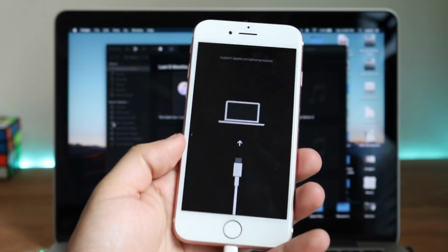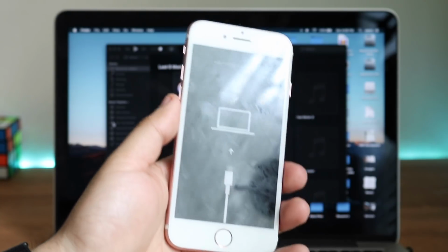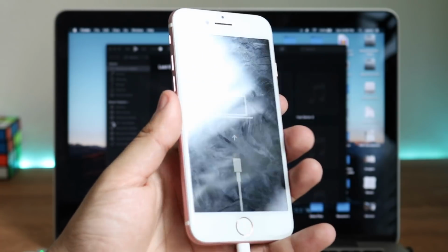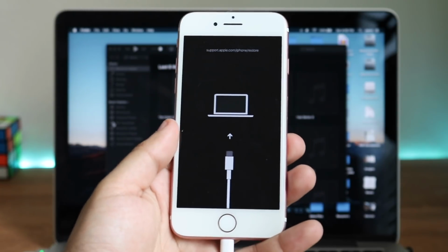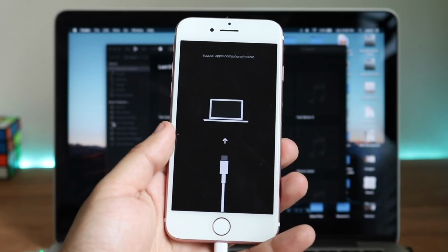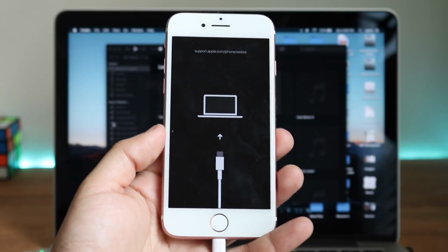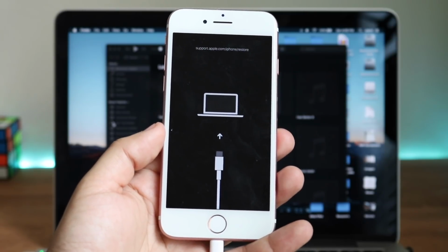What helped me out a lot though is that when it's going through a restore, just holding down the volume button actually sometimes enables you to get into it rather than holding down the power button. If your device is in a continuous boot loop, that can actually help you out. And that's something I don't necessarily see in a lot of tutorials. So I'd recommend looking at those other tutorials in the description below.